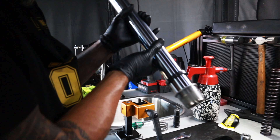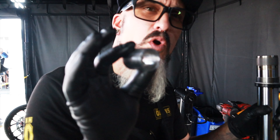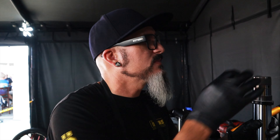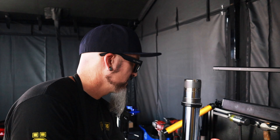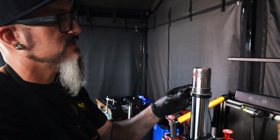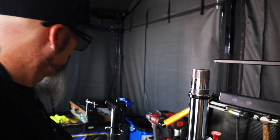Turn the fork tube upside down — this is very important. This is your oil hydraulic lock cup. These forks don't have a mechanical bump stop; they use this hydraulic lock cup that hydraulically locks when the fork fully compresses. That goes in at the end right there. Give the bushings a little grease, and grease the outside of the fork seal as well.